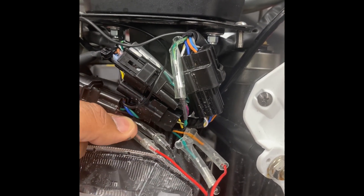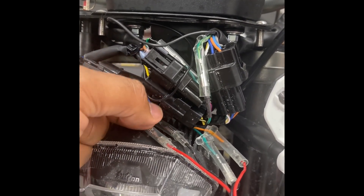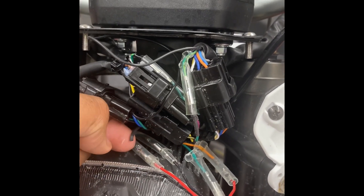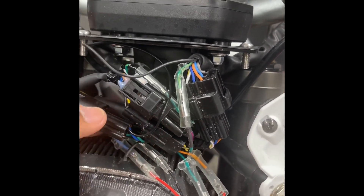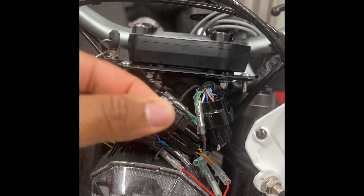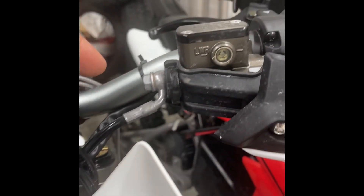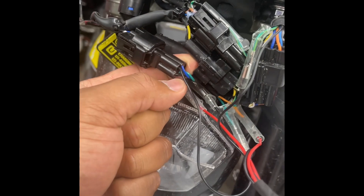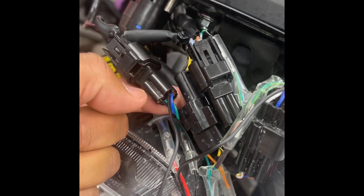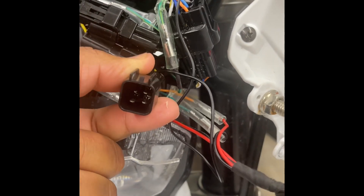This is what that wire looks like — I cut it off, shrink-tubed it, and pressed it in. My shrink tubes have glue in them, so it's isolated and won't make contact with anything else. So we cut that off and now we add a new wire here — I believe it's 20 AWG. I fished it through the rubber grommet all the way to the left combination switch so it could lead in where we're going to solder. We're cutting that constant power on the top right if facing the connector, or top left if facing it from the pin side.